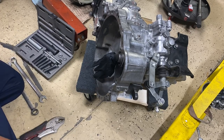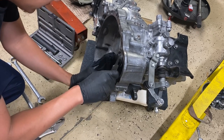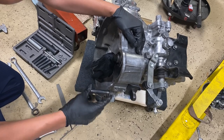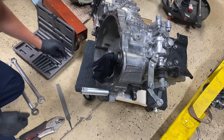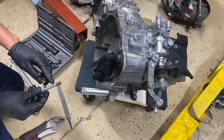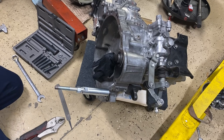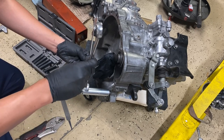Let's go ahead and get this dowel pin removed. We're going to roughen it up a little bit with the sandpaper, and then this should slide right over. This piece touches the transmission, and we're going to get the housing over it. There's also a little spacer. I usually put some anti-seize in here so that way it doesn't get stuck later and comes off easier. Get yourself a 21mm to put it in place and a 19mm for the bottom nut.